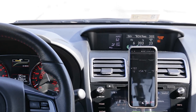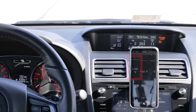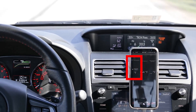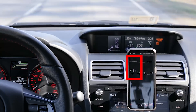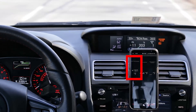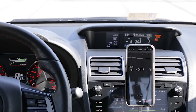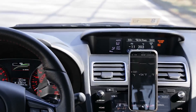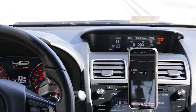After another 10 minutes of pretty dynamic driving, my CVT reached its operating temperature right around 180 degrees Fahrenheit. This is on a stock car driven somewhat conservatively, so if you're doing launches or flooring it or you have power mods you can expect your temps to be higher. For me, I want to get some baseline transmission temperature so that when I add the transmission cooler I know exactly how much it's helping, and when I start adding mods I know how much they are stressing my transmission versus the stock setup.